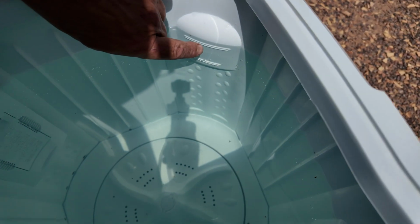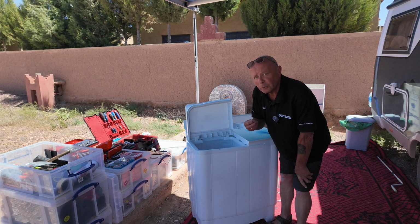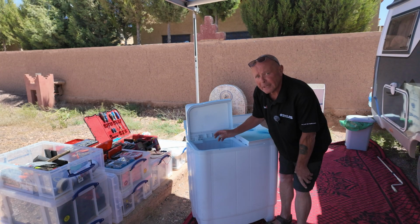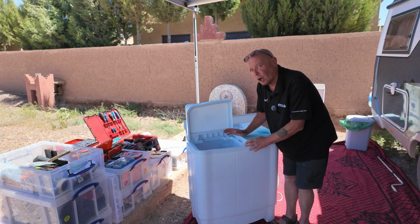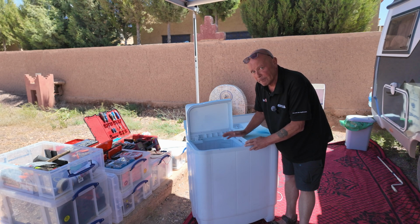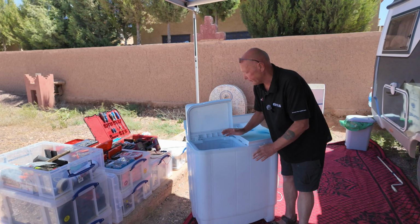It is very important that you do have the correct amount of water in the machine, not only to get a good wash, but to make sure the load is taken off the wash plate and the gearbox. Do a little often is my rule of thumb. If you do this, the machine will last a long period of time.